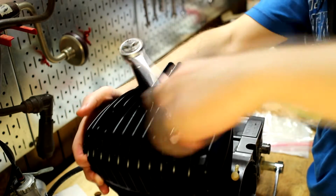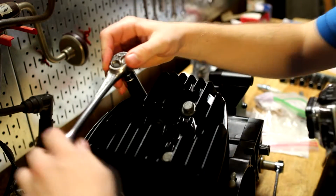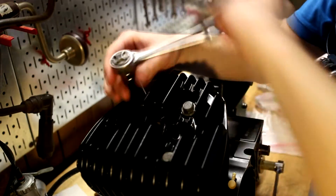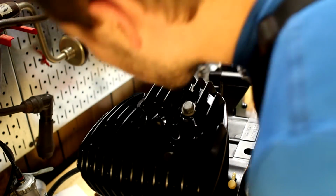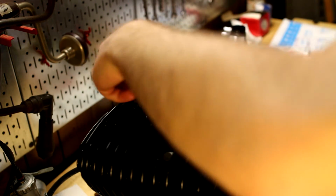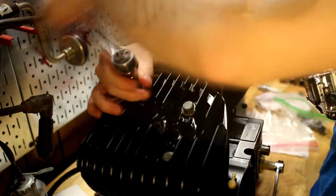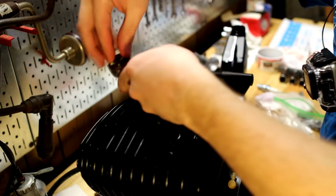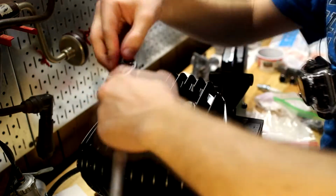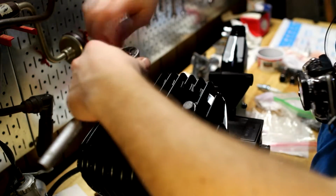See, this one is the one that's going to be tough. If there's a head bolt that doesn't come loose easy, next time this has to be taken off, it's going to be this one for sure. So I'm going to take it out and then put it in again, just for the sake of it. I don't know if it's actually going to help, but hopefully it just makes it not so caked on mud. Yeah, I'm going to do that again once it gets to the bottom, just to loosen it up. That's usually what you do with rusty stuff. If you get it to move at all, usually it's tightening it first, if you're trying to remove it, and then you just go back and forth like that.